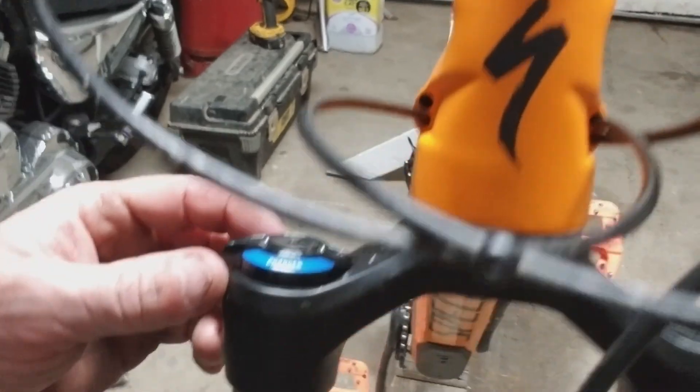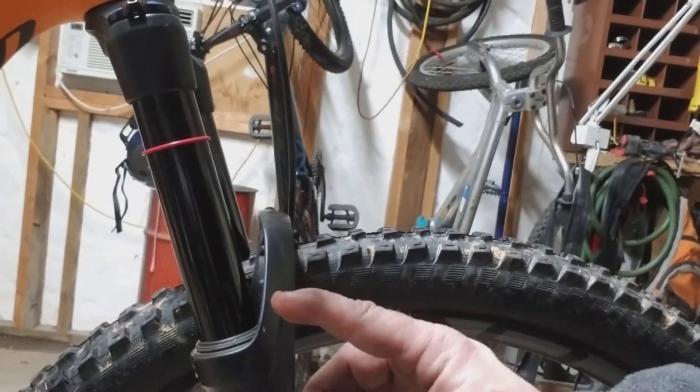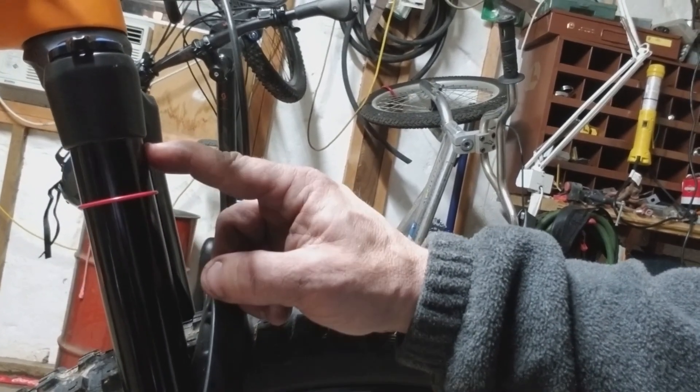It's dark out, but I went outside and did some really big bunny hops after putting in those three volume spacers. I'm running this compression — or 'Charger' as Pike calls it — at halfway. You can see on the stanchion here is my o-ring, and here's bottom out. I don't want to bottom it out, so I'm going to do a test and remove one of the pucks to go back to two tokens.